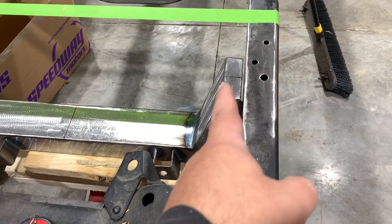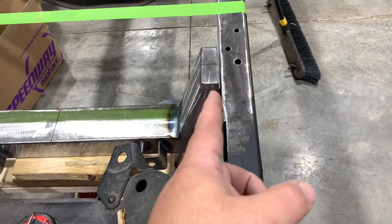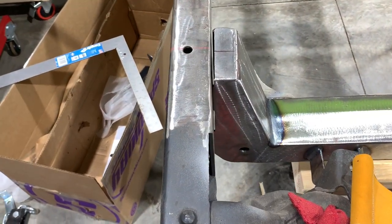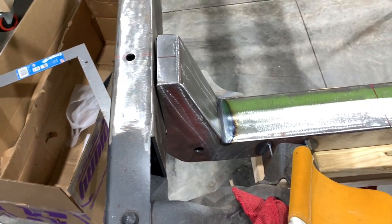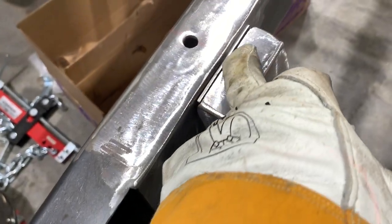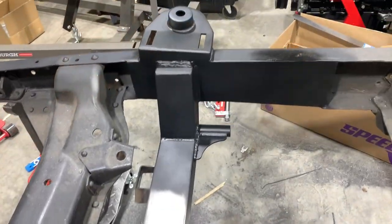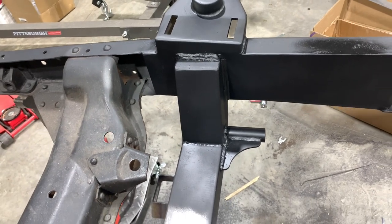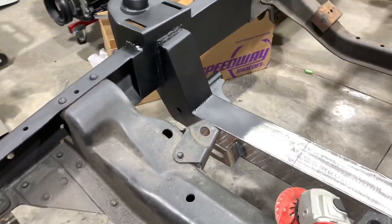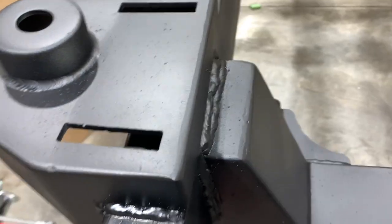The issue I'm going to have is we have a little bit of gaps here. If I would have welded the plates on the outside it would have been too far in, and inside the channel where I welded those boxing plates were a little too far in that way. This side is a little bit closer but there's still a gap. So we got to get some shims going and try not to disturb the geometry. I cut a little piece of 1/8" shim, put it right there in the back so that filled up that space good, and just shot two little tacks on the corner to hold that shim in. That side is all welded in. I apologize — I was talking to the camera and didn't realize the batteries died, so I didn't get to film any of the welding other than you saw me tack welding it. That is all one piece now.